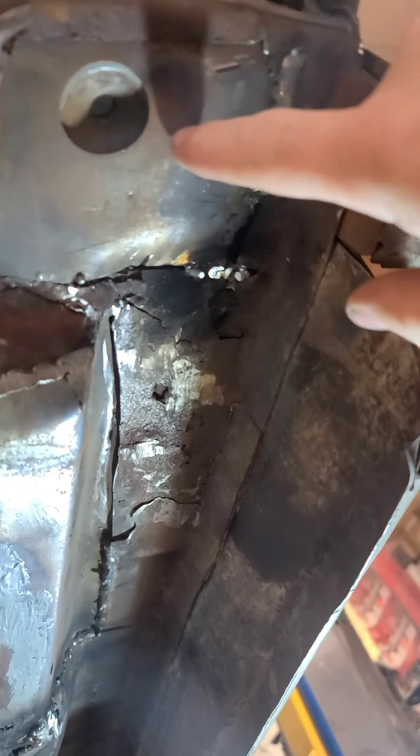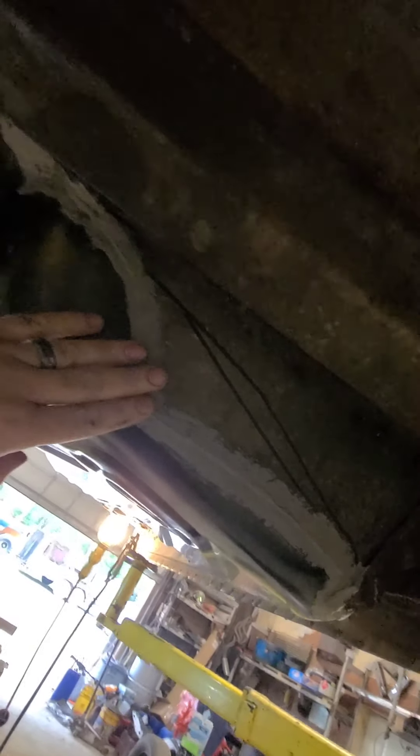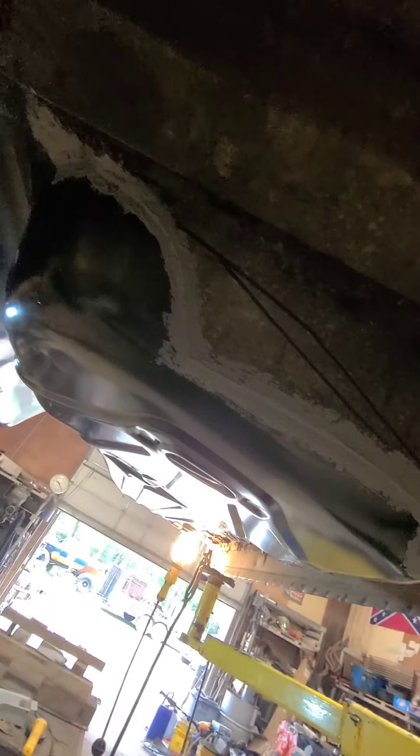This is the driver's side front body mount. This piece I did from the top when I did the floor. We did a floor from the seam up here - the pinch weld - all the way back here. It doesn't look the best back here but you're not gonna see it; it looks really good on the inside. This has all been seam sealed, it's been welded where it needs to be welded. I've still got all this to clean up - as far as I know I don't need to do any more rust repair back here.